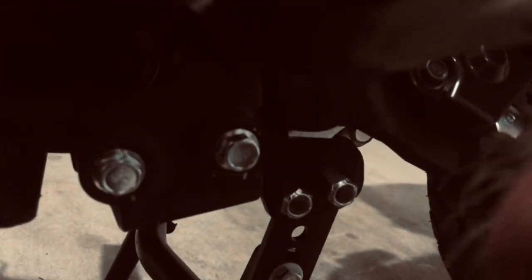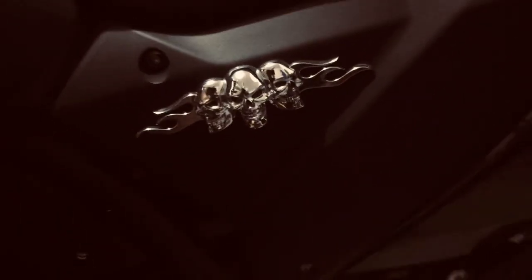The thing I did today is I actually put a center stand on it. A company called Happy Trails makes these specifically for the KLR. I actually ordered it two months ago and it came in this Wednesday. There it is — it's installed and the bike's up on it right now. It bolts up to where the foot pegs attach, so it's super solid. You can see how solid the frame is on this bike — big steel frame, heavy duty. Everything on this bike is super heavy duty, way over-built. They call these things tanks for a reason. It bolted right up; they sent you four bolts, two for each side, so you replace the standard bolts and bolt that right up through the mounts on the frame. Works excellent.